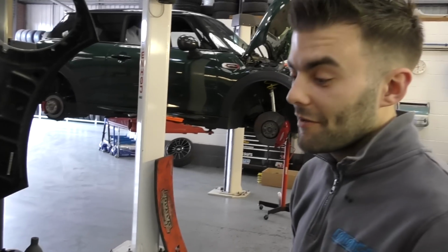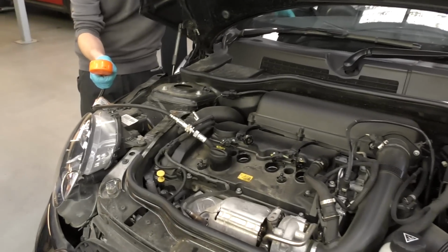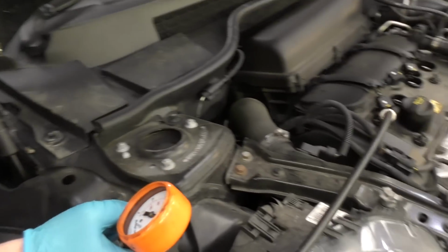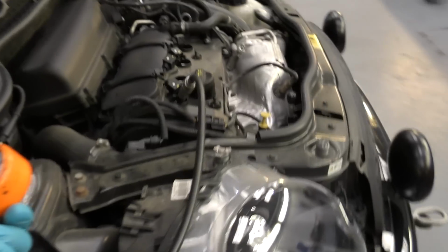That knocking noise is alright, right? Yeah, it's just standard N18. It sounds like a bag of bolts. Normal Mini. But a strong engine, we think. Strong. Okay, next up we've got a compression test. Is that good? Yeah, 190 psi. Good, excellent.